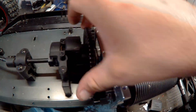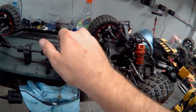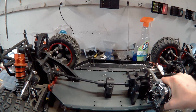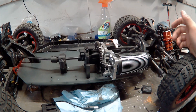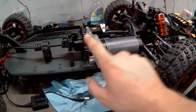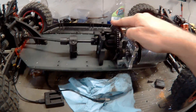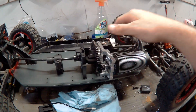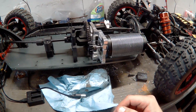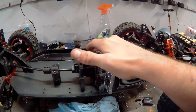There's gonna be a lot of torque on this car. It's a 960kV motor. Looking it up, the DBLXE electric version actually has an 800kV motor — I'm surprised by that. It's using a 12 or 13 tooth pinion, so this motor and 18 tooth pinion combination may be too big. I'll see how it does; if it overheats I'll backtrack and put a 12 tooth pinion on it. I'm using the stock spur gear from the gas version — it's mod 1.5. Should have a pretty cool sound.